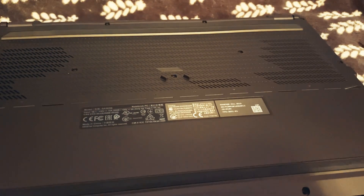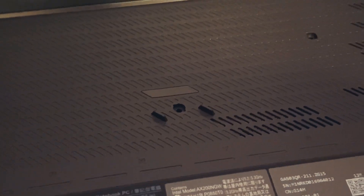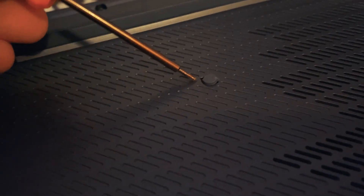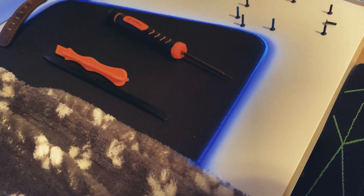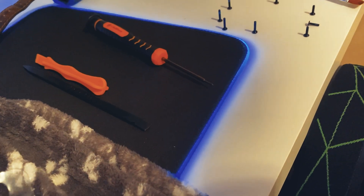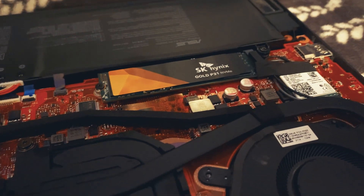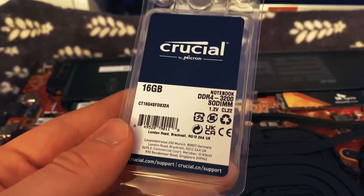So let me talk about how you replace the RAM in the G15. All you've got to do is remove the screws on the sides, and do not forget to remove these three screws in the middle — they're underneath little rubber caps, which you can remove with a screwdriver. I use a really small screwdriver from a kit I bought on Amazon, which I'll link in the description. Once you've removed those, you can open it up. You can see I've added another one terabyte SSD, and here's the Crucial RAM I bought — it's dual-rank, 16 gigabytes, 3200 megahertz.